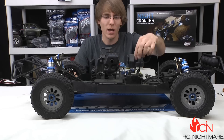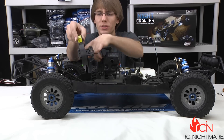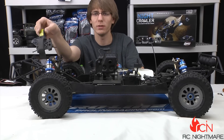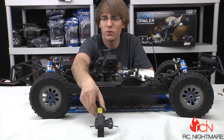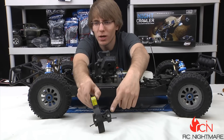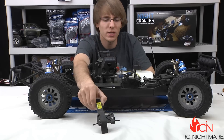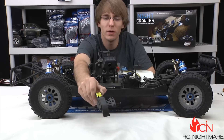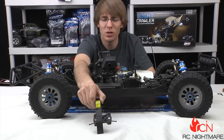The first thing you're going to do is remove that top brake bracket. I already got it disconnected to show you what I've done with it. You can see these two screws sticking out the side here — I've left them in so you can see the angle they're drilled at. I drilled two very small holes on each side matching the angle of the bracket. They're actually perfectly perpendicular to the bracket, and it was just undersized of three millimeters — whatever drill bit you got that's a little bit small — so that you can thread them in by hand. You don't want to over-drill and have them loose. I think they're like 20 millimeter screws.